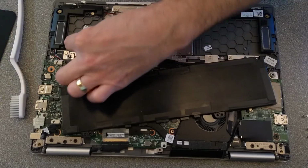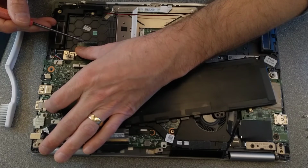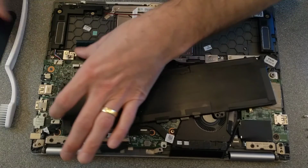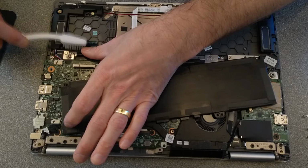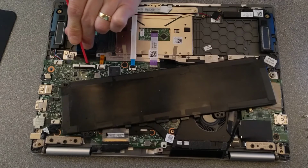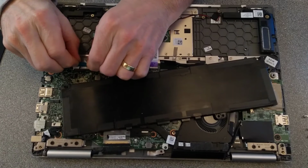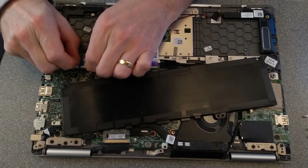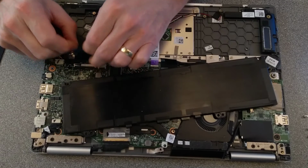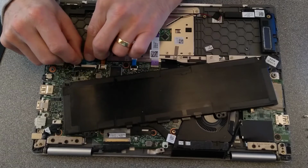I would say it does look like there's a lot of corrosion, or some corrosion, on this connector. If you look about there, the colours are a bit weird towards the upper end. For good measure, I'll also do the keyboard slot. And using the ribbon itself, I'm just inserting it and removing it to try and move some of that spray across the contacts. And plug it back in.